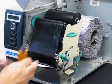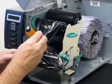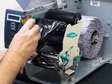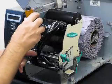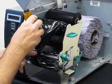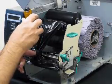To adjust the print head, loosen the inside left or inside right print head screw on the side that needs to be adjusted. With the screwdriver seated on the screw, you can slide the print head forward or backward as needed. We suggest pushing the print head all the way back in the printer and gradually moving it forward. Test print after each adjustment, and remember to carefully tighten the screws as well.